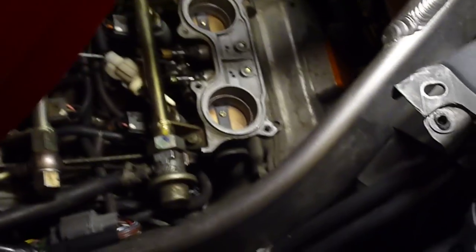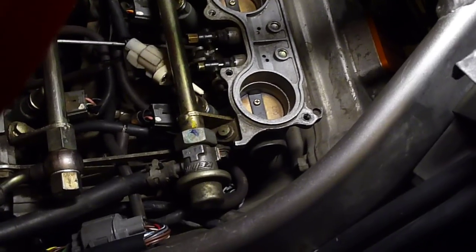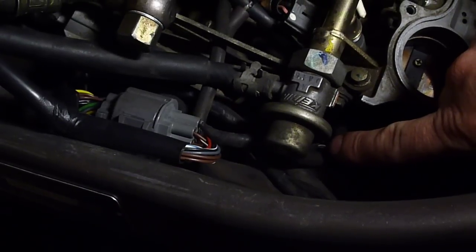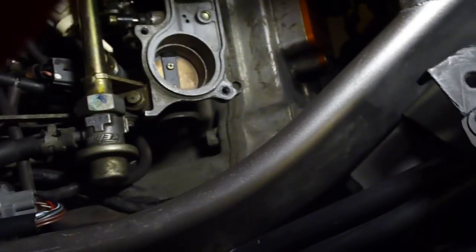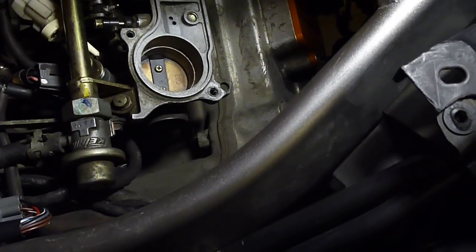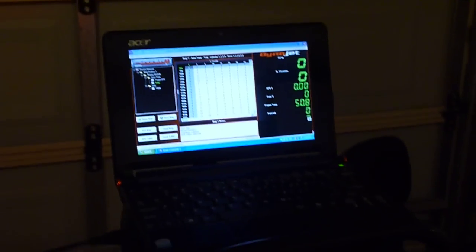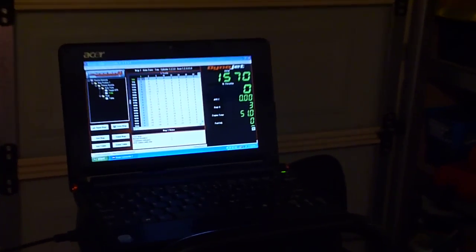What I'm going to do is put the camera on my left hand — a little bit dodgy as I do this. I'm going to start the bike and plug and unplug this vacuum hose, which is just hanging loose at the moment. I'll be pulling it off and on to show you how the ratios go. I'll start the bike, wait for the O2 sensor to heat up, and then we'll do it.